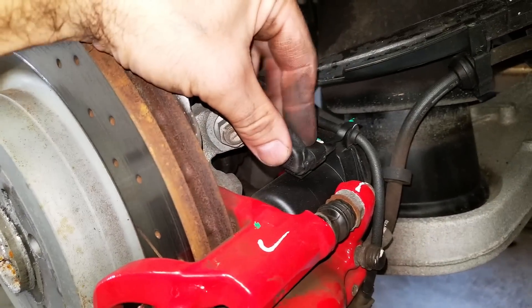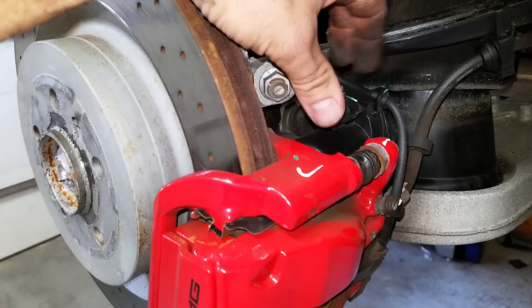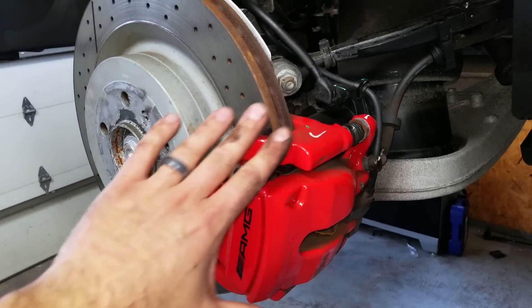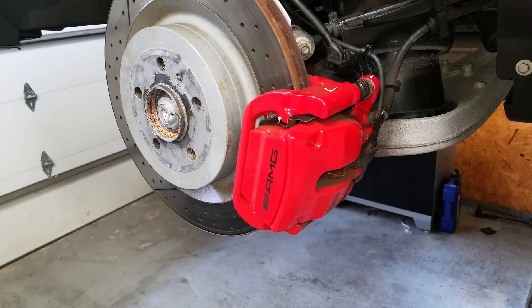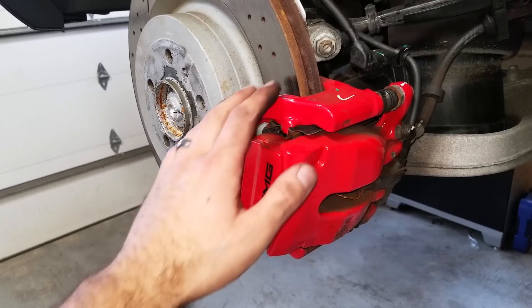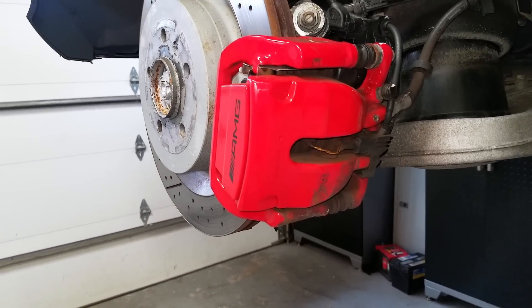The main reason I wanted to show you this car is because it has a different style caliper in the rear — a traditional caliper bracket that you might recognize from regular everyday cars. These do have slide pins that need to be greased. The difference here is you just remove this bolt and this bolt and pop the caliper off. Spread those pads a little bit, then lubricate the pins — simply pull them out, you can see the grease in there, put some lubricant in so they slide back and forth. Everything past that is the same — you'll have two separate caliper bolts and caliper bracket bolts, very easy, just like replacing standard brake calipers.